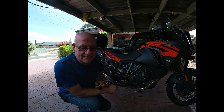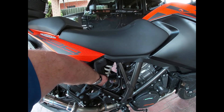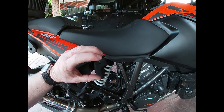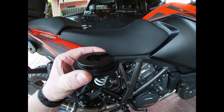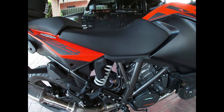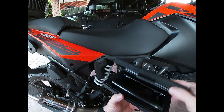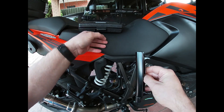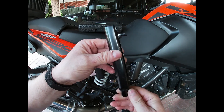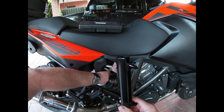Now here is the back shock, here is the spring, and the bit is under the bottom. What you have to do is compress the spring with the back wheel hanging down, compress the spring and the bottom bit should come out, then you just slide the new one in — it just slips in. To do that, I bought a Ballard's off-road spring compressor tool. You hook these onto your springs, put a bit of rubber or something in between so you don't scrape the white paint off, then you just screw it and this compresses your spring — one on each side.